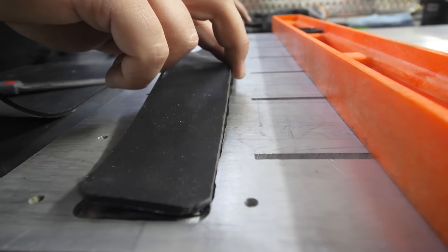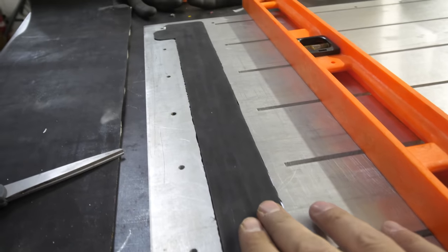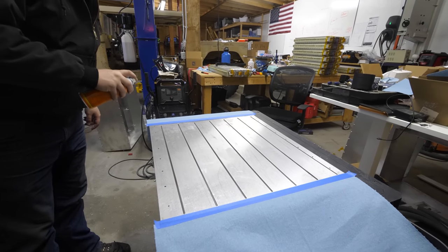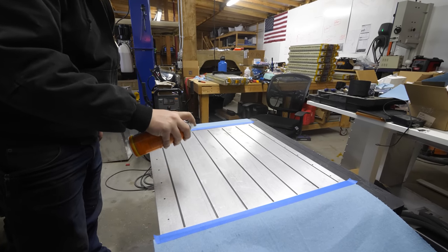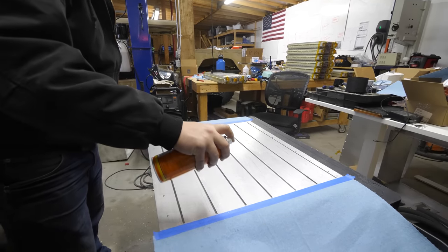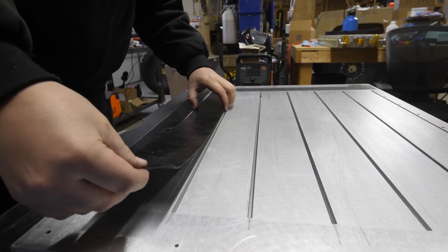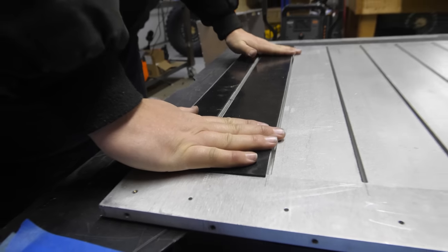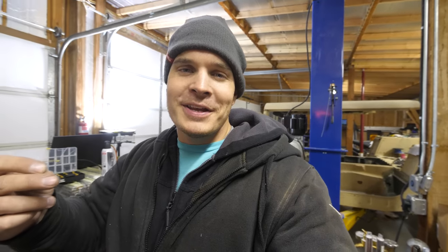The slots routed underneath the terminals give a little more distance from the metal. The rubber running lengthwise between the slits on the base plates is more about dampening vibrations for the batteries — it's not doing much insulating. The vibrations aren't a super big deal since we'll be mounting the batteries inside the Hummer body, where they'll be dampened by the mounts between the body and frame, and again where the frame connects with the shocks. So the vibrations should be pretty well mitigated unless we start jumping cliffs.